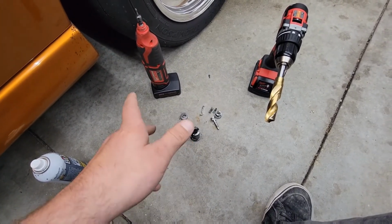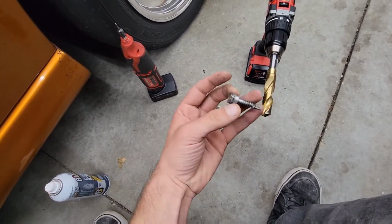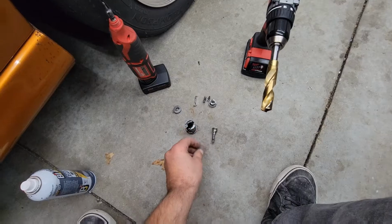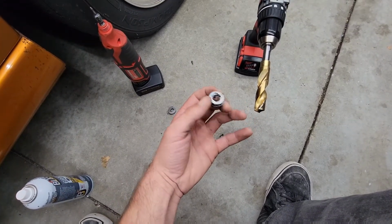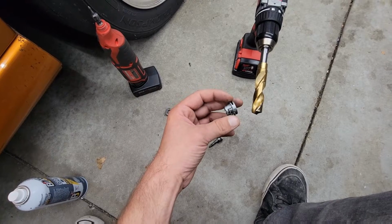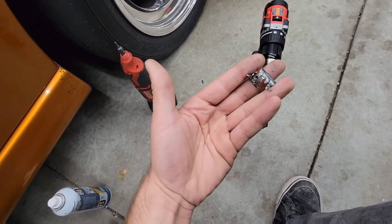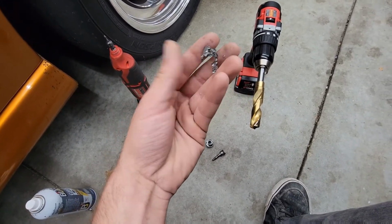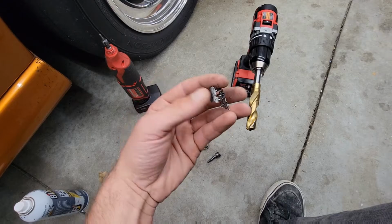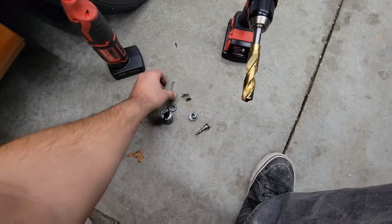a new lock cylinder and a new tumbler made if you are stuck in the position where you have to drill it out and basically destroy all of the keying information, not the grind of the key, but the order in which the tumblers are seated into it. And here's pretty much the only remnants left that aren't just completely metal chips of what the inside of the tumbler itself looks like. Which kind of sucked, but thankfully I got parts here pretty quick.